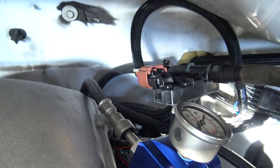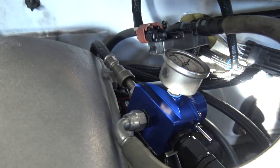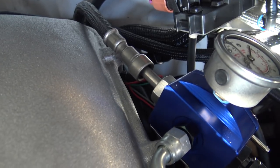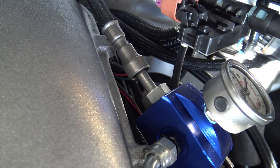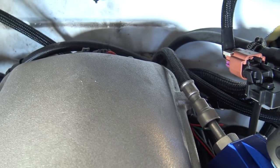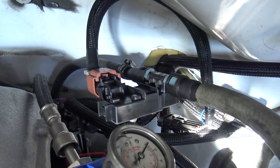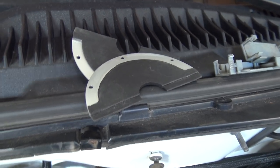This is feeding from the back of the tank. This truck had feed and return — I don't know if it was returnless or if he modified it, but these later model trucks are usually returnless. That's the stock feed: three-eighths push-lock into an eight ORB — ICT Billet makes that, it's on eBay for about $8.99 to $10. Then it passes out of the eight into the T-fitting on the rail, fills all the rails, and when it's fully pressurized it comes out the return. There's my flex fuel sensor on the return, and I have it wired into the Holley already. Then we drilled out a three-inch hole here, which I have rubber grommets for, and once we're done confirming things we will seal it up.